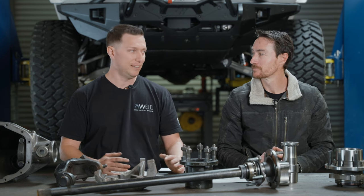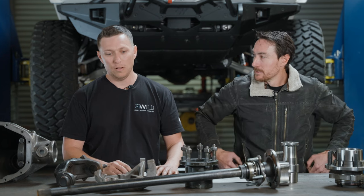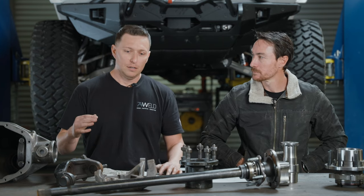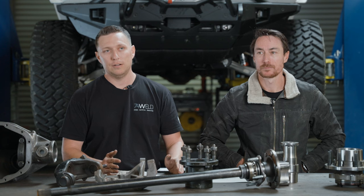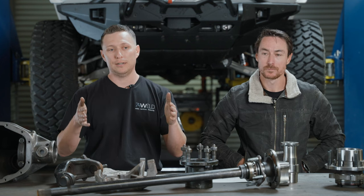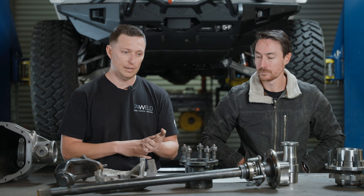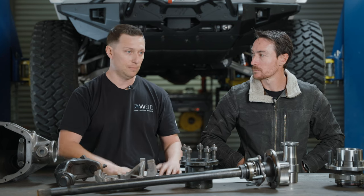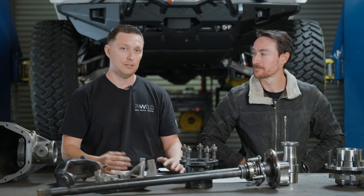The big failure mode people know about is tubes bending. You can gradually beat them and they'll start smiling — making a little smiley face. Comparing tube to tube: material, outer diameter, and wall thickness determine strength. Your tubes also have brackets on them — suspension brackets for leaf springs, coil springs, control arms. The biggest thing to look at for tube strength in a vehicle application is spring center-to-center, because the narrower your spring center-to-center, the longer the lever arm you have to the wheel. Also consider how much traction you can put down — if you're fully braking coming down hard from a jump, you have max bending stress and max torsional stress simultaneously.